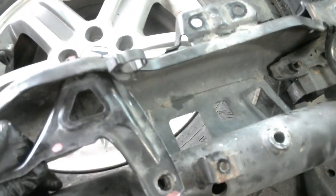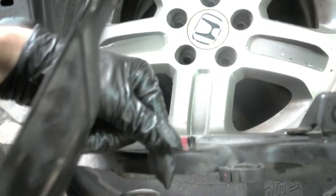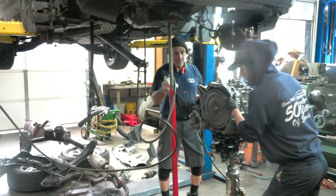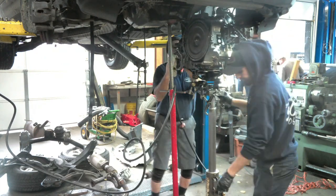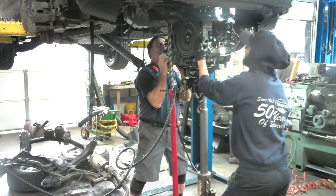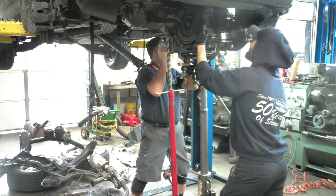The problem is a power steering rack goes right here and it's extremely hard to get to that bolt with the power steering rack in the way. So what we're going to do is cut this nut off right here and weld it on the inside of this bracket — that way we can put the bolt through this way and put the nut on the other way. With the bolt fixed on the frame it was a whole lot easier to get this thing in. That bolt hiding behind the power steering rack took me about an hour to get out during removal. We got this thing back in and Pops is helping me line up the transmission.